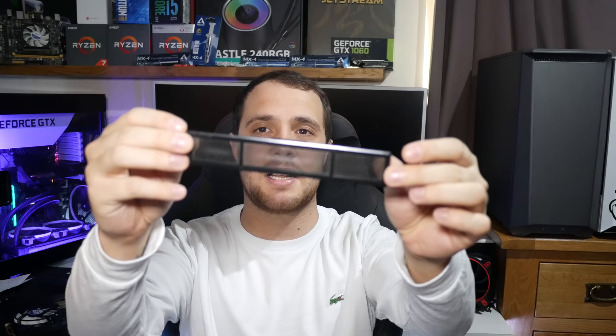The only thing I don't like about the case is the limited airflow on the front - you've only got these two grilles, and that little grill gets full of dust really quick. Once you start putting radiators in the front, even in a push-pull configuration, you get a real lack of air. But other than that I really like it. So we've got a Ryzen 2600, we're going to try to overclock it to 4.2 gigahertz with the cooler they've given me, do some installs, a quick overclocking guide, stress tests, and some gaming tests.